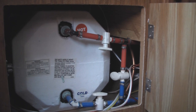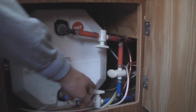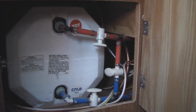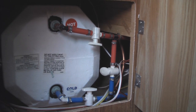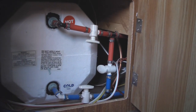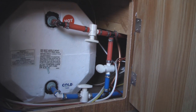If you have a hot water tank in your camper, this will be the configuration when it's enabled. You see that the cold water can run in because the T-connector is open and the hot water can run out. When you winterize your camper, you don't want to put antifreeze through the hot water heater as it's a real pain to clean out. You can simply discharge all of the water in the heater by removing the anode and letting it all drain out.